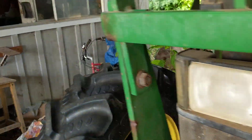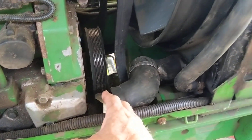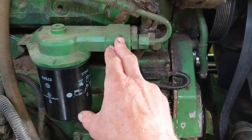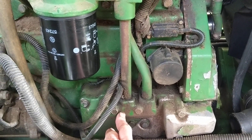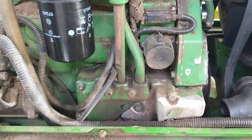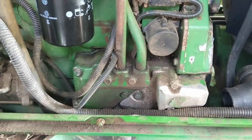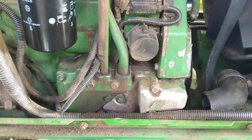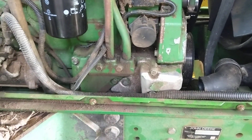On the right side facing forward — this is your bottom radiator hose going into the water pump, which I've removed. It also goes through the engine oil filter. On this model, the oil filter drops into an internal oil cooler. The oil cooler can be bad — either the cooler's radiator or, in our case, little O-rings went bad inside. When that happened, the oil pressure over-pressurized the system, it started blowing steam, and when I drained the coolant it was full of oil. The seal went bad and was pushing oil into the water.